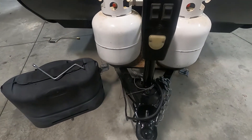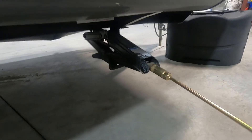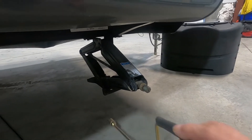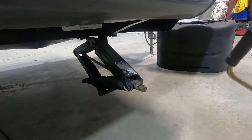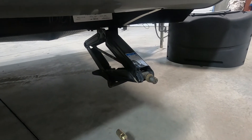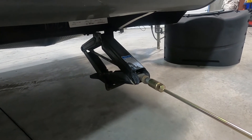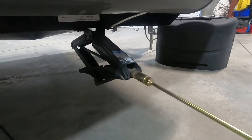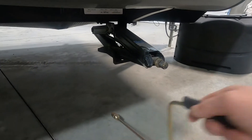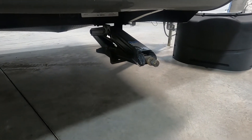Once you've got the unit level, the next thing to do is stabilize it. On all four corners you have these hand-crank stabilizing jacks — a 3/4-inch socket fits on here and you simply hand-crank them down. You can use an impact driver or drill gun and this will run down in a matter of seconds, but I recommend you slow down when you get to the bottom. Remember, these are stabilizing jacks, not leveling jacks, so you don't want to lift the unit at all — only bring these down until they're taut, preferably on jack pads. Jack pads protect the feet of your stabilizing jacks from dirt, debris, and hot blacktop in the summer, and better distribute the weight. You do have a 10% off coupon — go ahead and use it to pick up some jack pads. Run all four of them down on jack pads and you'll have your unit level and stable, then we can hook up our power and water.